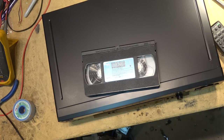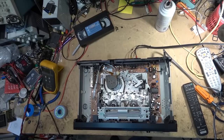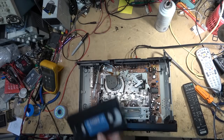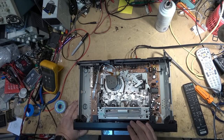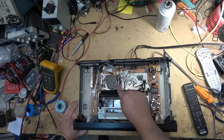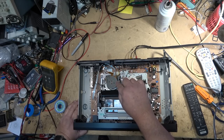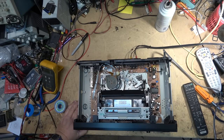Might be a mode switch. I was told that they couldn't load a tape but as you saw when I plugged it in, the tape popped out. So let me just get the top off this thing. I want to observe what's going on when I try loading the tape. The drum's not turning, and of course it's trying to play but there's no picture because the drum is not turning. So we have a drum failure on this - either something on the drum board, something on the motor board, or something on the main board and the servo. That's where we're going to begin.